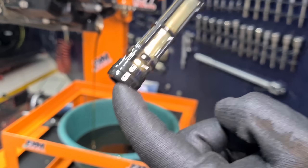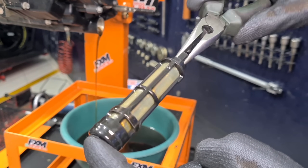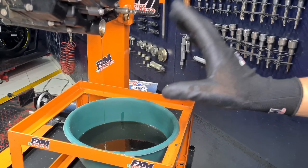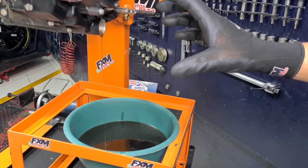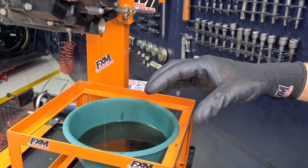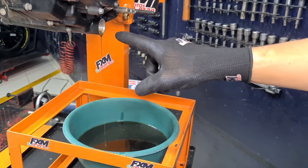Here, as a first diagnosis, we can see that our oil filter is in perfect condition — it has no metal shavings. If there had been any metallic particles in our oil drain, even though with the stethoscope we identified that the sound was in the cylinder head, we would need to do a complete engine disassembly: first to clean the entire engine — this is very important — and then to diagnose other parts that could have been affected by those shavings.